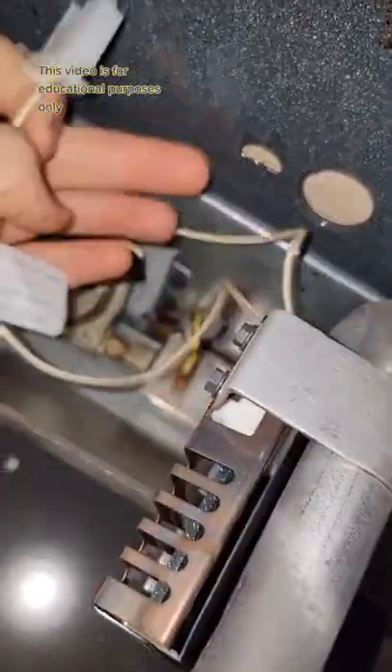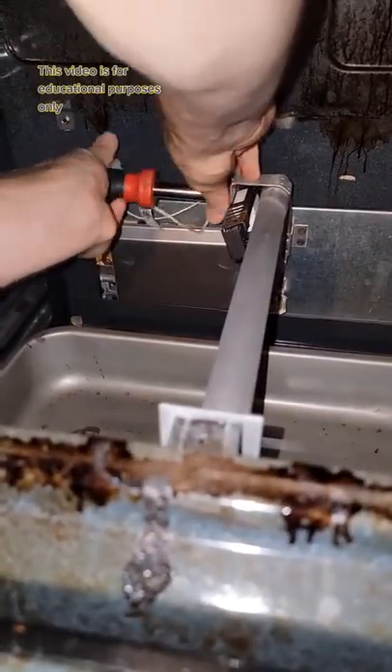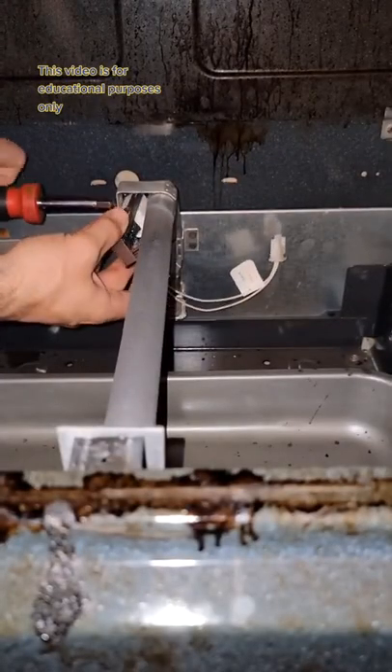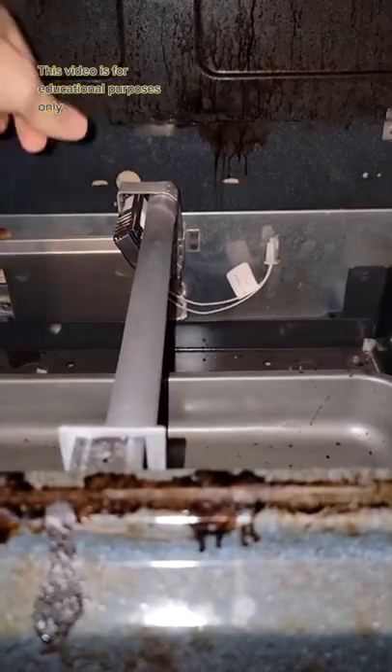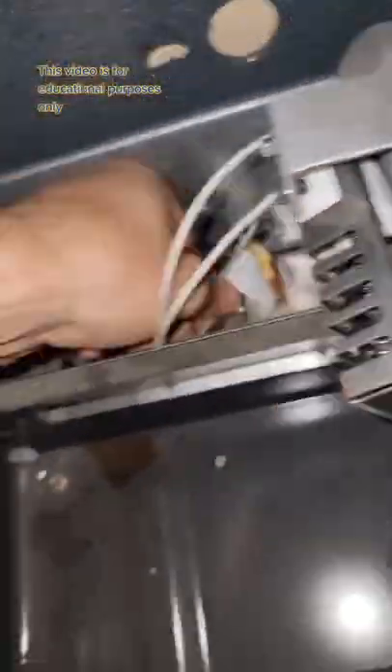There's going to be two wires here, connected with a plug or sometimes with wire nuts. You can unscrew it from the burner assembly and get your new one, screw it back in place. This one is a generic one — they're only about 20 bucks, but you could look up the manufacturer's model number and get the specific one if you like.